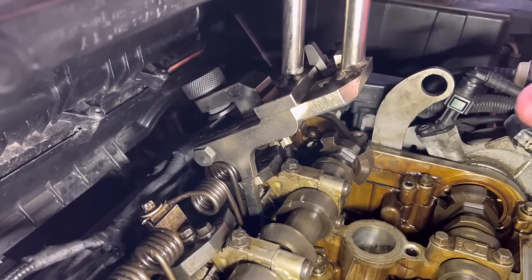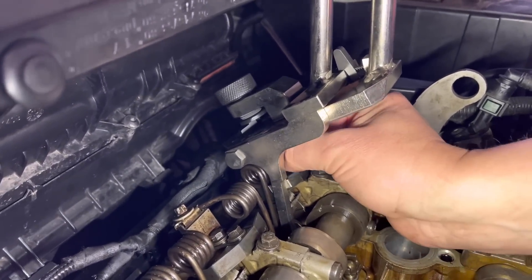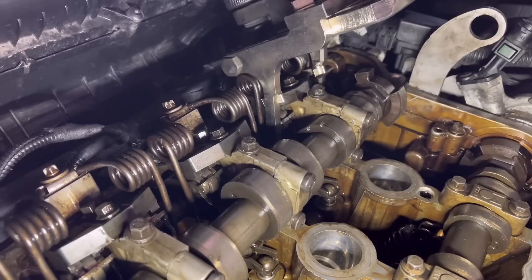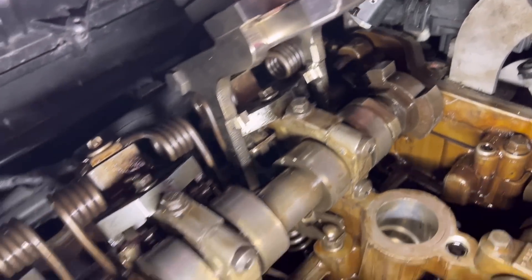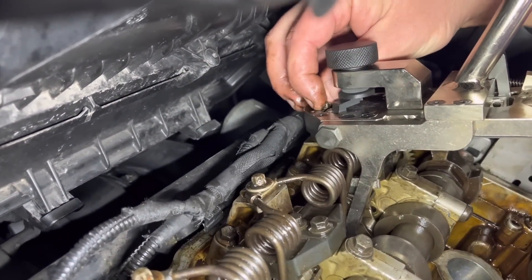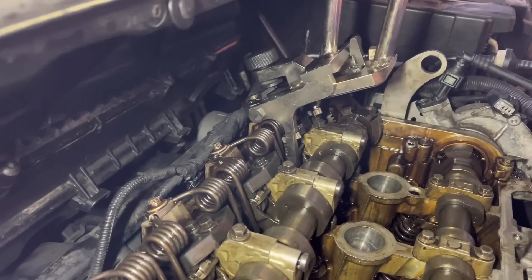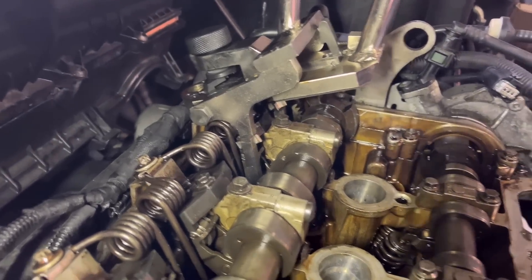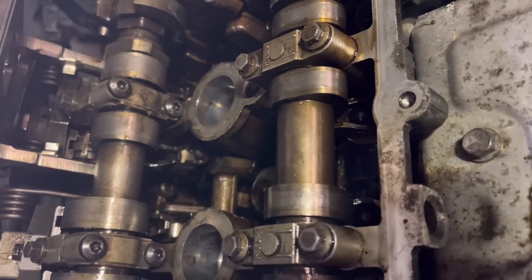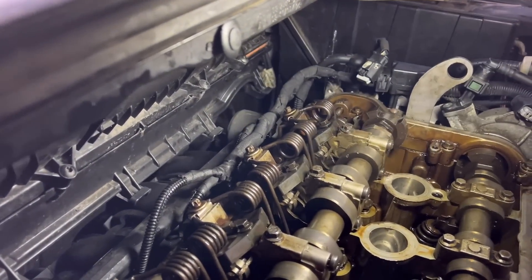What we do is take the front bolt — which is the shorter bolt — and put that in the front and do this up finger tight as much as you possibly can. It's probably best to make sure the thread is pretty good before you start this because you can only do it by hand. Then once that's done as much as you can, we put the back bolt into the top of the spring up here and do that one the same again. Now what we do is release the jig tool and make sure that at the bottom the prongs are sitting in the locators right at the back where they should be. Then if we undo this, you should be able to take that out and it's all in position.